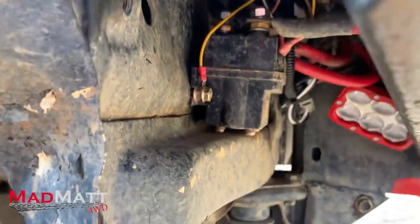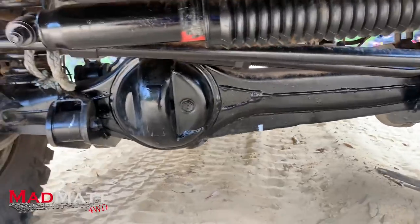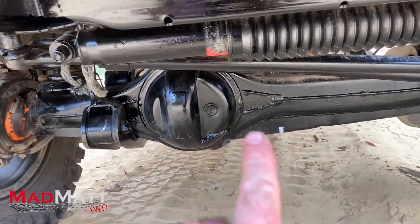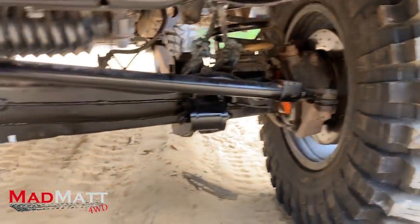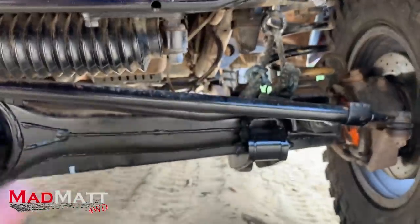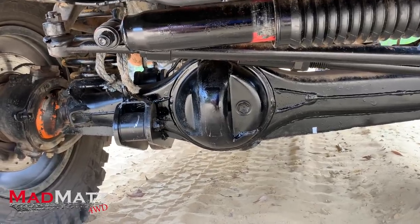With regards to the winch, this is the winch controller — an Albright solenoid — and all of the in-cab controls come to that and switch the power. With regards to the front differential, this is a stock Toyota Land Cruiser housing but we've got a lot of bracing on it. We've braced from the knuckles right the way through — all of this is bracing out to that knuckle, and we've braced the top side of the knuckle too. We've got an upgraded steering arm, tie bar, and upgraded Panhard rods — a superior unit that's adjustable so we can get the track of the axle centred into the vehicle.